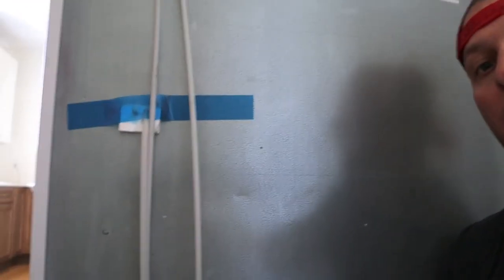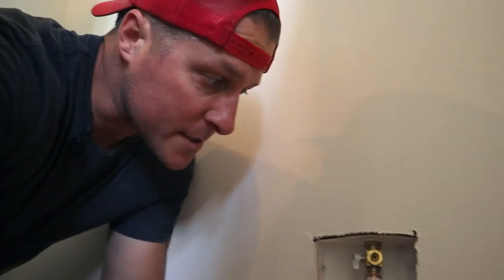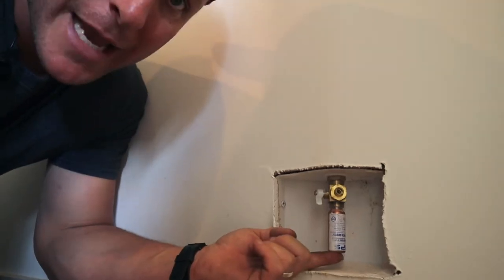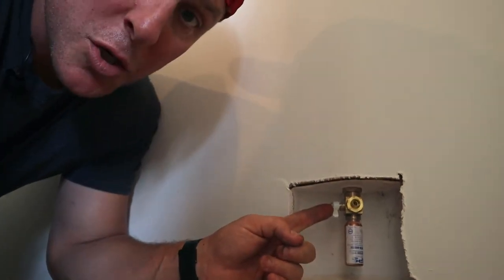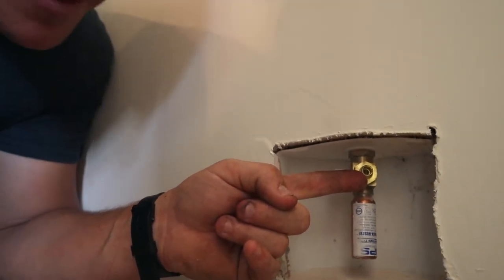All refrigerators have a plastic line coming out of the back. As you can see, ours is plastic — it's about three-eighths size and it goes down to an end hanging right here. All the ones I've seen on the refrigerator side look like this; they have a little bit of slack and a stock line that comes with it. This is a quarter-inch male thread on the refrigerator end and that will fit perfectly on our line, which has a double quarter-inch female thread. Now for the wall side, if you have a newly built house, you're going to have something similar to this — a little copper canister attached to the bottom and an on/off valve. We are again met with a quarter-inch male thread, so that's going to work perfectly.